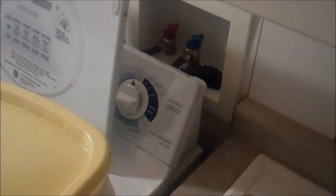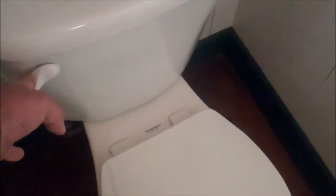Generally, before I start, I run a bunch of hot water, and then I have cold water sitting aside in the refrigerator or something like that for usage. But come in and turn all the spigots in the bathroom, kitchen, back here in the laundry room. Just open those all up. The spigots to the washing machine are already open, but you can double check and make sure they're open. And you can flush the toilets, make sure they're empty. Hold it open so all the water goes out.